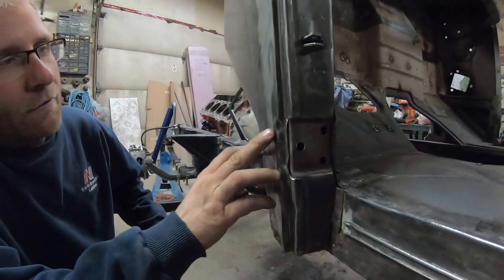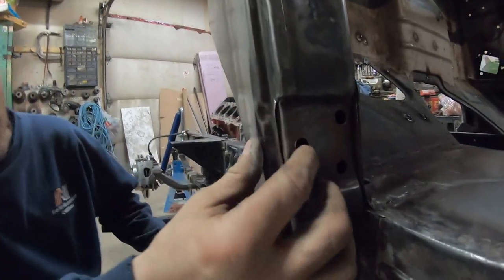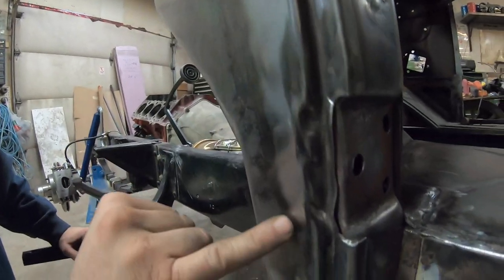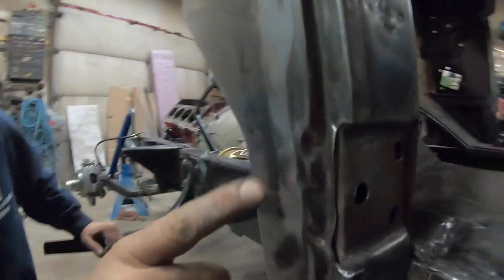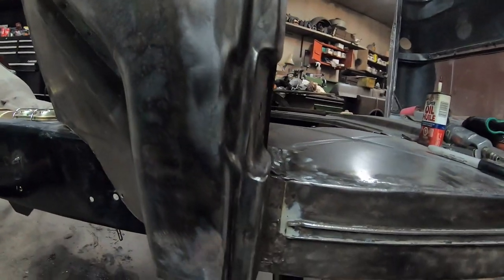We're still doing some body work on this cab. We actually found this part here that looks like it's been rippled, probably to do with worn door hinges, and we also found another stress crack here. So we'll just end up marking this out and cutting it out, and we'll show you how we do it as we go. I don't know if the camera will pick it up, but it is all ripply. So we'll just make a little pie cut and cut it out and make a new piece, but we'll show you how we're doing it.